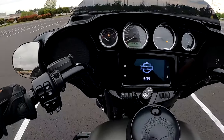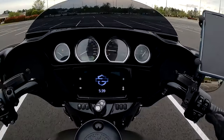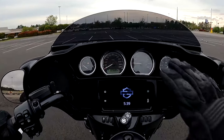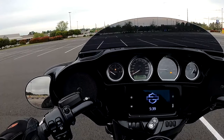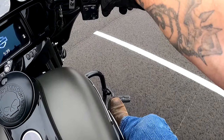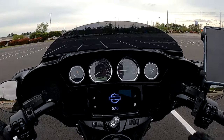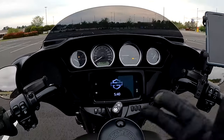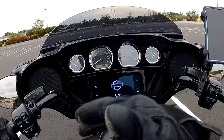This is a great exercise to practice right in your garage on a flat, level surface. Once you get used to it, if you have an incline in your driveway, practice trying to hold yourself there using the clutch engagement point — you may not even need the brake once you get good enough. Just get it to that pull point and hold it, then add some throttle. In the next video we'll talk about how important that throttle and clutch relationship really is — stay tuned.